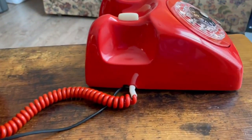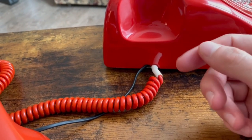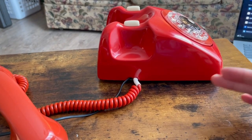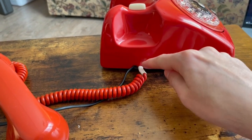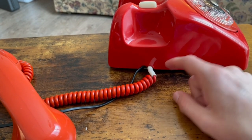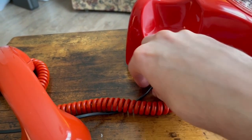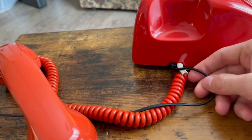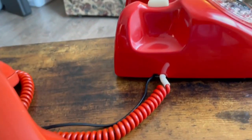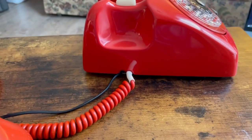The other issue with this telephone was the cords. The phone was definitely not working with how they had the cords set up — they had electrical tape wrapped around both cords and had chopped them off. I chopped up the cord a bit and put some spade tips on the handset cord, and also put a restraint here, which was actually from another Ericsson phone I had gotten for parts. It's white, but it looks a lot better than before. I kept the original black cord, as those were what the phone was equipped with when the hard-wiring cords were removed. I still need to replace the jack because it has a broken clip, but I'm going to leave it for now since it doesn't affect functionality.